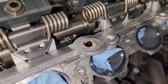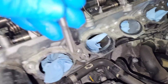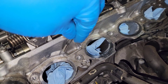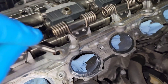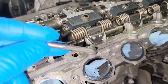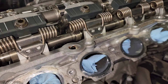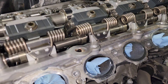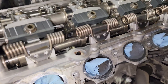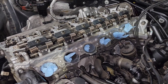Now we actually plug the head ports. All we're going to do is tap these holes — you're not tapping all the way through. Apply a little cutting fluid to the tap threads, thread it in, then insert the set screw and tighten it down so it seals the port shut and prevents boost from going the wrong way into the crankcase.